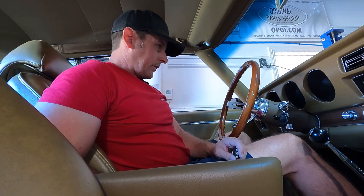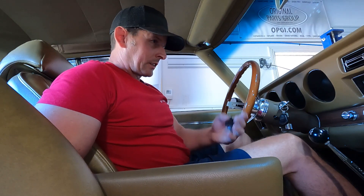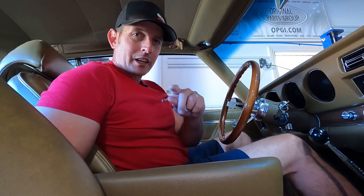Fire in the hole! I can hear it — it's building pressure, 60 PSI. I don't know if you guys can hear the whining, it is very very faint compared to that last Holley pump — go check out the first video, it was super loud. I'm going to turn it off now, get under the car and check for leaks at all my connections and especially where I welded, to see if it's holding fuel.